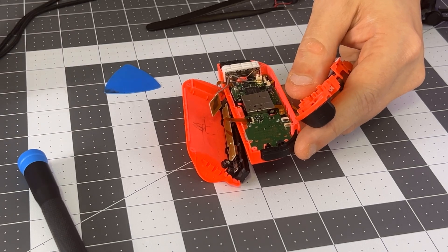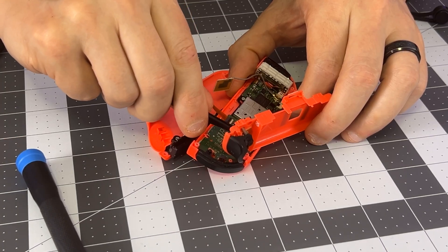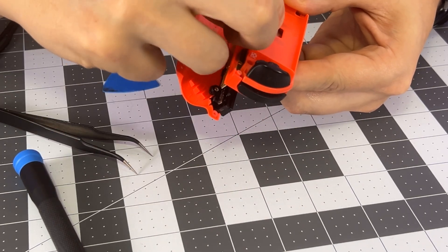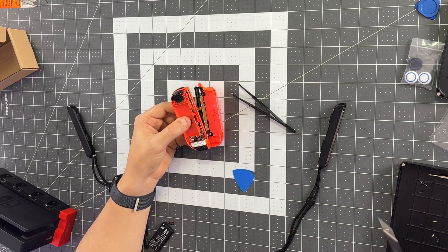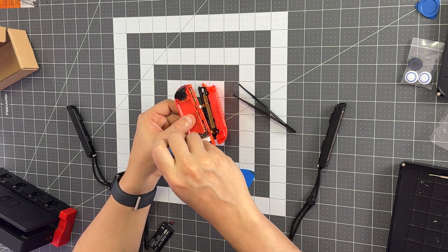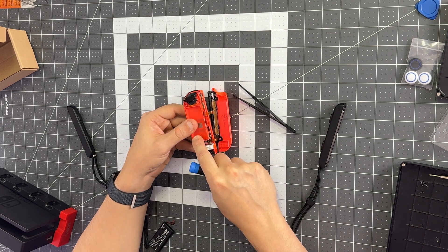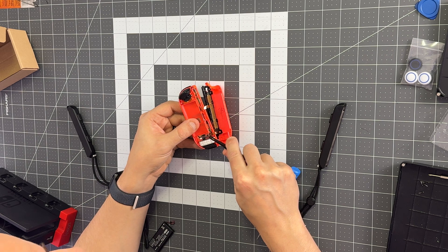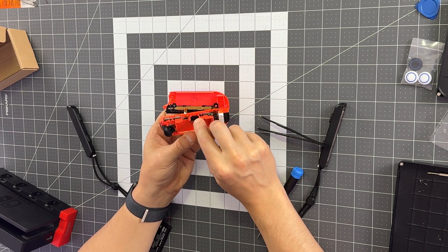Before you put the frame on, you'll need to reconnect this very short ribbon cable, then close the connection point and slide on the mid-frame. This piece pulls up through here, curls around the opening, and slides into place—you can use tweezers to tuck it in properly. We're going to screw on the mid-frame first to make that a little easier. These were all the same size, unlike the other side of the controller. One in the bottom, one off to the side, then up top. If you forgot to connect earlier, you still have access here. The cord slides into grooves just like an old VCR.